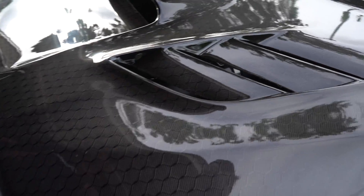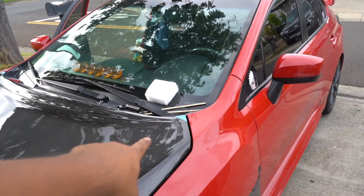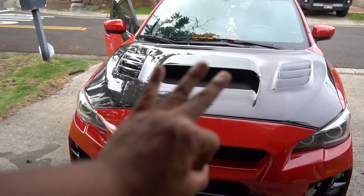Dude, look at the detail of this. How's the spacing? I think that side is wider - this side is a little bit thicker than the other side. Let's open it back up again and shift the hinges - two bolts on each side - just so slightly. When it comes to adjusting your hood, you can get everything bolted on, but the minor millimeters - that's the part where you're gonna have to tweak. It's simply undoing the bolts just a little bit, shift it to whatever side you need to. That looks way better now. New hood - three, two, one.